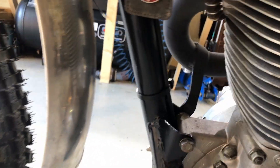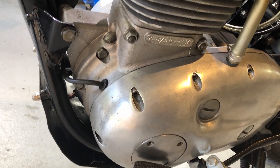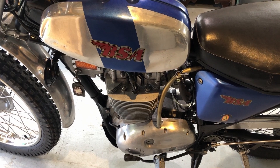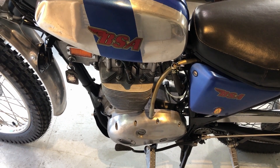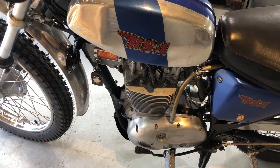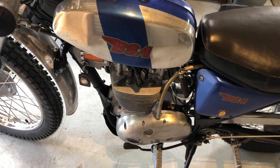Apart from the sump guard, which I've had to drop down a little bit more to accommodate the aluminium thin sump - that's on there just in case. It's just a case of taking the plug out instead of unbolting the whole sump. I've had another go at cleaning up the valve and valve seat; if it's not successful I'll be drilling the valve seat right out of the timing case, putting a steel plug in there, drilling and tapping it to suit the ball bearing, making it a hard seat.